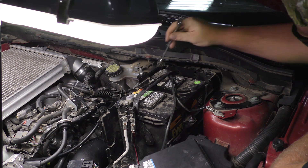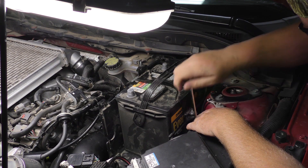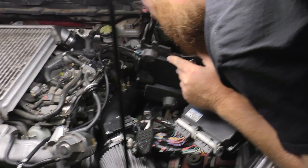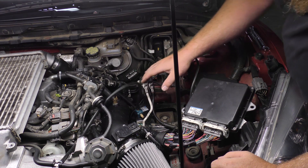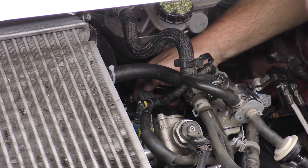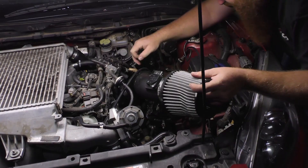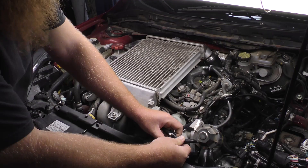Disconnect the battery and remove it from the engine compartment. Unfasten and remove the battery box. Unplug and remove the PCM — this would normally be affixed to the battery box, but our vehicle has been modified and it has been repositioned to the top of the fuse box. Disconnect any sensors, plugs, and hoses, and loosen any clamps securing the air intake. Remove the air intake. Our vehicle has been modified so these steps may differ for you. Loosen the clamps at the intercooler inlet and outlet and disconnect any vacuum hoses.